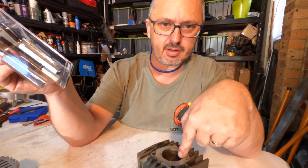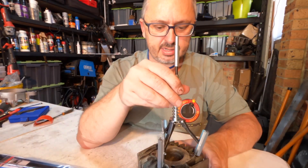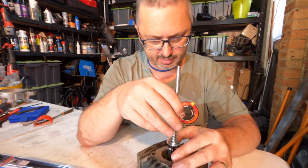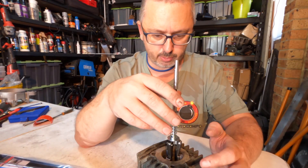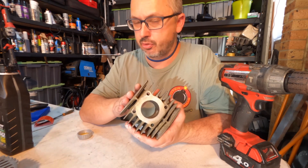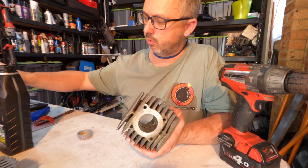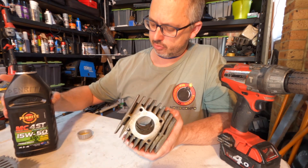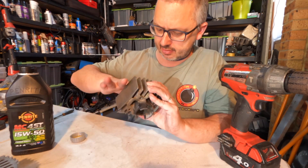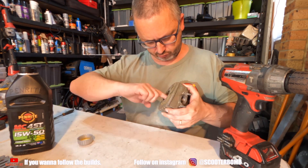Considering most brake cylinders are about the size of this bore, I thought it would be the perfect tool to do the trick. And as you can see when it opens up, it is definitely big enough. We close it up and we drop it inside — it is going to do the job just sweet, absolutely perfectly. Now before you re-hone the cylinder you want to make sure it is extremely clean. I've used some prep solvent and a paper towel and blown it out quite well. Mineral oil is the trick here, and I'm going to coat the inside of the cylinder nice and sweet — really coat it up well, the more oil the better.